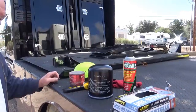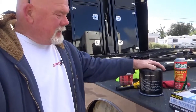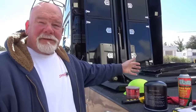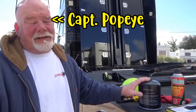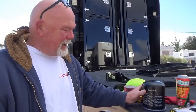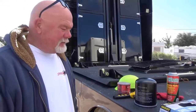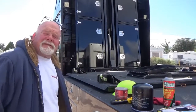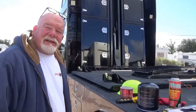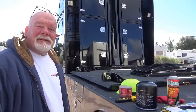What does that thing do? It filters and dries the air that's in the system on the truck. It goes from the compressor to this air filter, filters all the debris and moisture out of the air, and then it goes into the holding tanks of the truck and disperses out through the truck as systems require it. What happens if you never change it? Well, your systems get all polluted and get grease and dirt in them, and then next thing you know your brakes aren't working right. So it's good to change it.